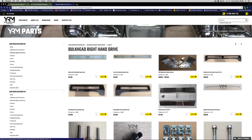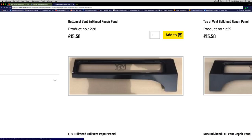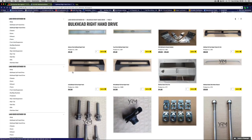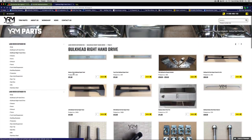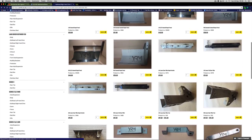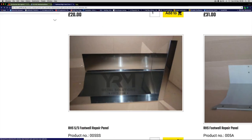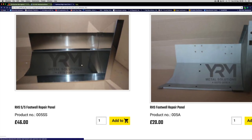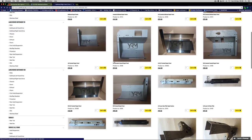Going back one, you can see these are the two halves — you buy the two, you get them a little bit cheaper. The bulkhead repairs will come up as and when I have the finances to do it — this is not a cheap project. Footwell repair panels in stainless steel — brilliant. Stainless steel, of course, can be welded to mild steel just using a normal MIG welder without any problems.